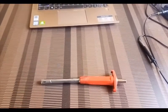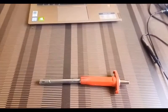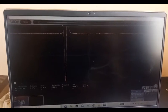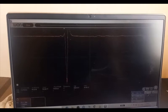I have taken one practical measurement and I will show on the laptop how much pulse is coming. You can see this pulse is generated. This is 50 volt per division, so the total showing is approximately 500 volt peak to peak.